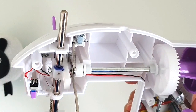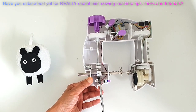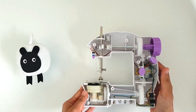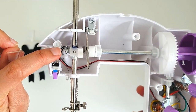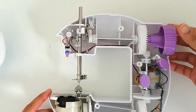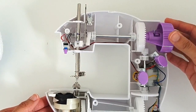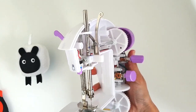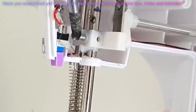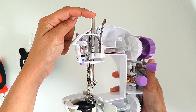Can you guys see that blue mark? That's where it's grabbing it. Now I'm going to loosen the screw. I know that's really, really loose now. You can see the screw has actually physically come away from the shaft significantly. And now look what happens when I turn the hand wheel — the needle isn't moving. Look at the needle, it's not going up and down. And now if I show you the shaft, there is a hole right there. That is where this screw was positioned. And because I undid the screw, this plastic bit could not grab on, and so the needle is not moving up and down.